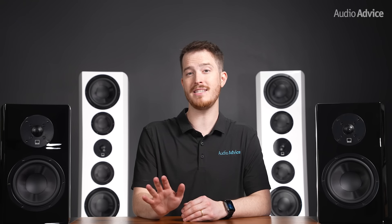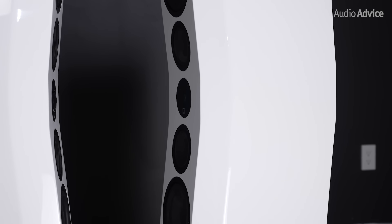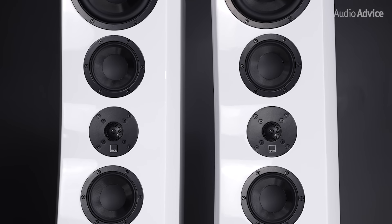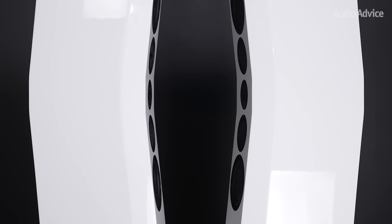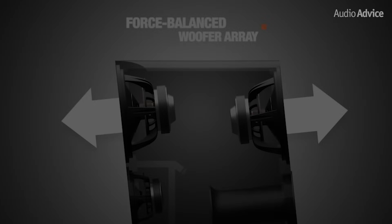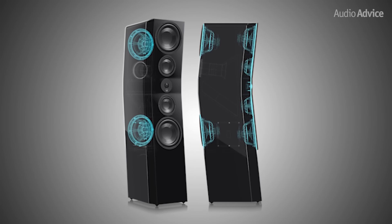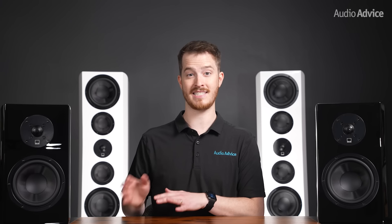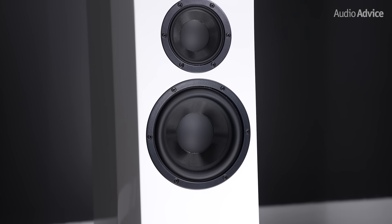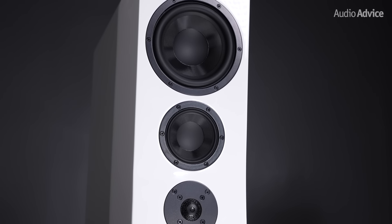Now let's take a look at each of these new models. The new towers are the models catching all of the attention, and deservedly so. With their striking acoustic alignment design and thundering, fast, and deep bass capabilities, most people who hear them think there must be a subwoofer on in the room. All three — the Ultra Evolution Pinnacle, Titan, and Tower — use a push-pull woofer system where identical woofers on the front and rear of the cabinet form a force-balanced array, with a pair on the top and the bottom. This method has far less room nodes, giving you very even bass across your entire listening area, and the opposing woofers also cancel out internal resonances, quietening the cabinet even more.